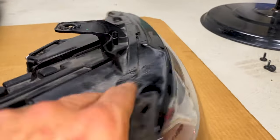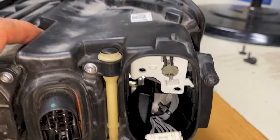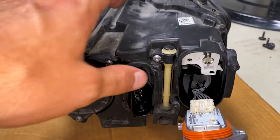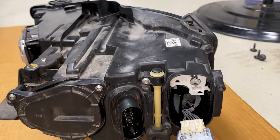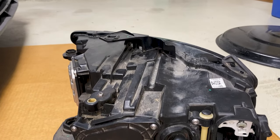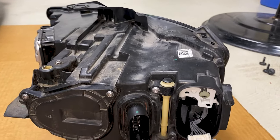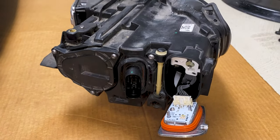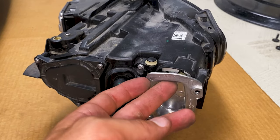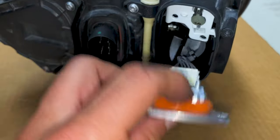The way it works is the LED is up against this tube — there's a clear plastic tube that runs the length of the headlight and that's what shines the LED for your DRL. On mine, I'm either going to try and clean this tube or I bought a second donor headlight on eBay with a cracked lens and all the electronics removed, and I can see if I can swap out the tube. There's no way to pull this tube out without actually opening the headlight. If your DRLs are out completely, you can look for these chips and replace them. You can also swap them from side to side — if you have one out on your passenger side, you can take the chip off the driver's side. They won't bolt up because they are right-to-left, but it is the same chip so it will plug and play.